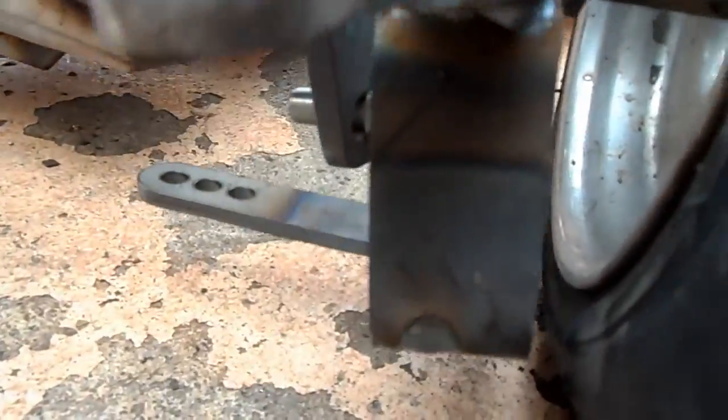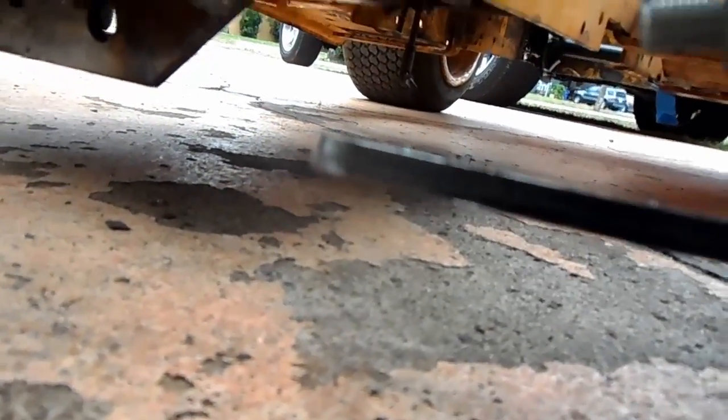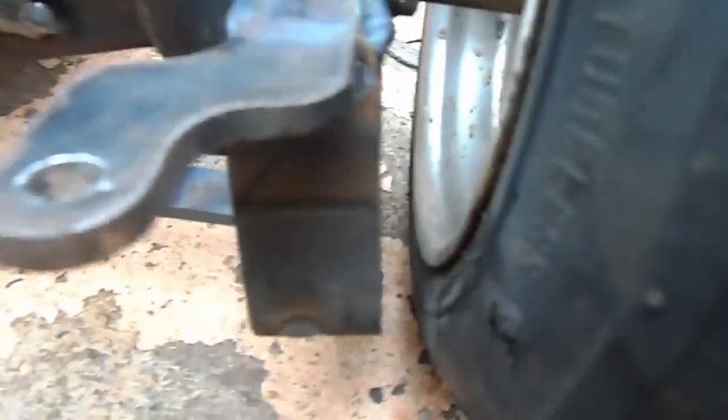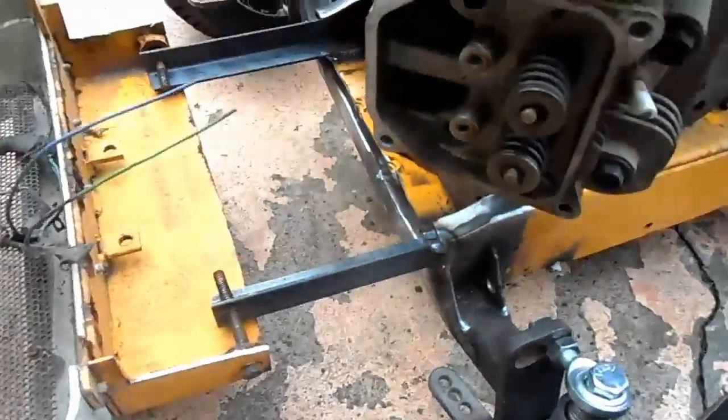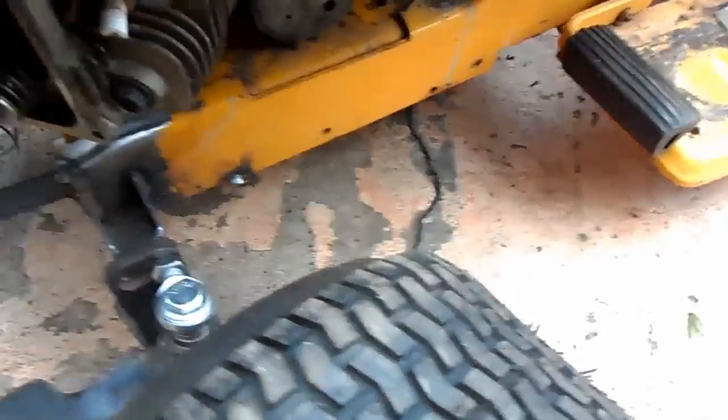I've got my steering tower bracket here. I bent that up, and I got the arm fully welded on it, so that's going to be kind of the view. The steering will come out from underneath the mower up to the front here with a Heim. I've got to clearance this better for the tire because I got to pull the wheelbase in on it. But everything's welded up. I just got the dash right. Got the dash just sitting there temporarily, just for mock-up.